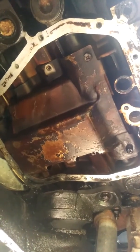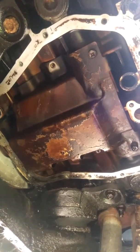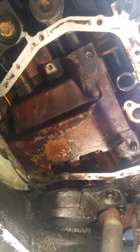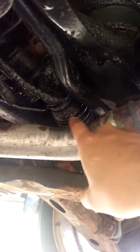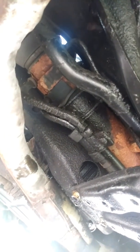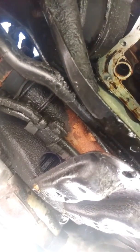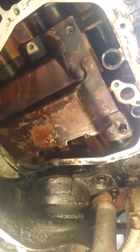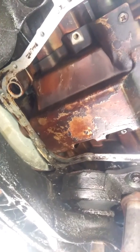Make sure it's got a nice clean seat and make sure it seals right, or you're just gonna run into a handful of problems. Also, when jacking up the motor, be careful with the exhaust — there's not a lot of room. On one side I noticed it was starting to pick up a line a little bit when we were lifting it, so just be careful, don't put too much tension on something that can't handle it. Pay as much attention as you can to detail. If you have any questions get a hold of me — you can add me on Facebook, Ryan Hoshal — subscribe and let me know.